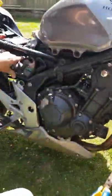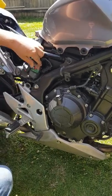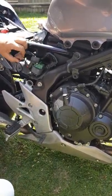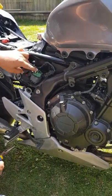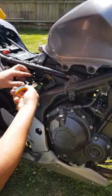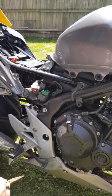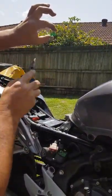Now over here we've got the power lead running over inside this solenoid here, and there's a main fuse, which is here. So we pull that off. As you can see there's a fuse just there — that's probably a 25 or 30 amp fuse. Just carefully we'll pull that off and have a look at it. Yeah — just there, as suspected, you can see it's broken.